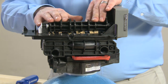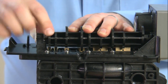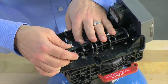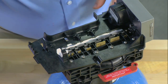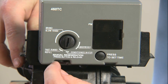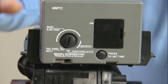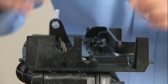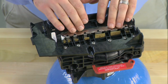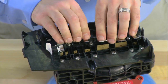We can then move up to the top plate of the unit. We can remove the cam by rotating the gear on the back to allow the cam to come to the side. The valve disc will push it out to the side and we can pull it towards the rear of the unit. Once that is removed, we can move to the front of the unit where we locate the pin that holds the timer down. We rotate this down and pull it forward, then grab the timer and pull straight up.